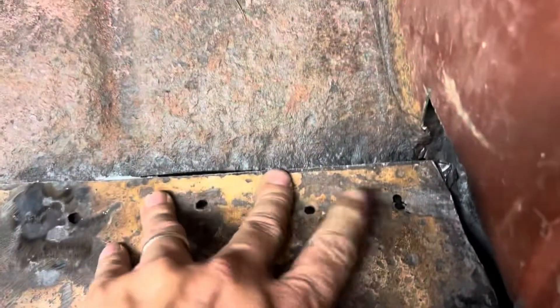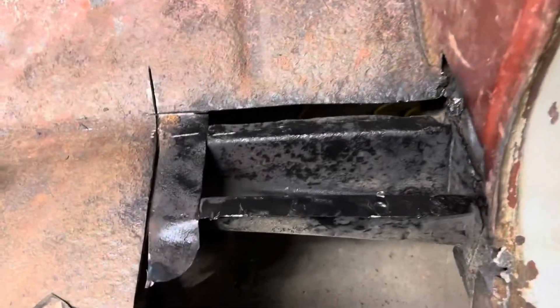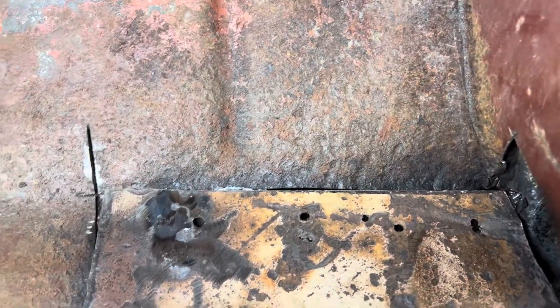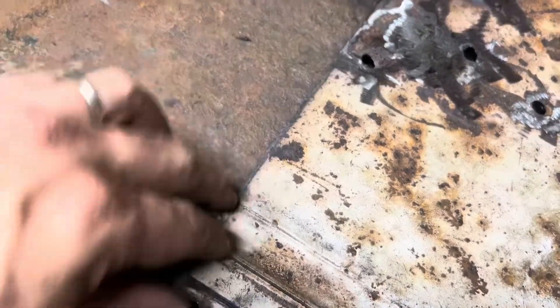This is where I'm at - I've got that piece cut out of the parts cab and I like how it looks up in there. That little bit of gap there will be okay; this will actually move over and fit just fine. I've already cleaned all this up and painted it down in there as best I could. When I get that over there it's going to be covered up, these holes will all be plugged back up. I'll start in this corner right here, tack it in that corner, and this will all move over. I'm lining up good with this floor indention here.